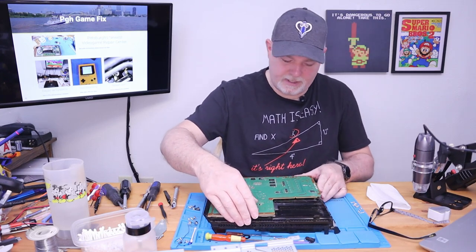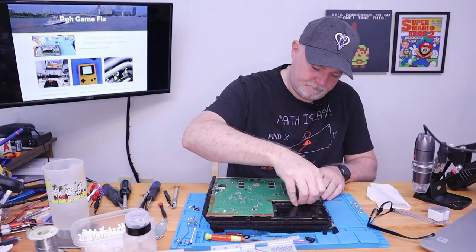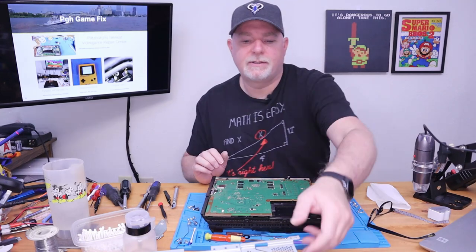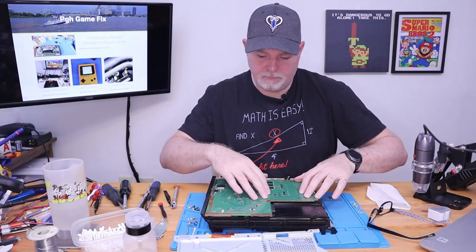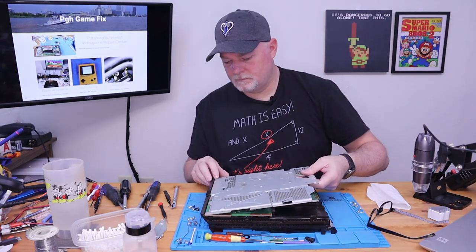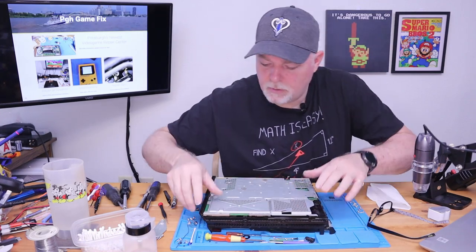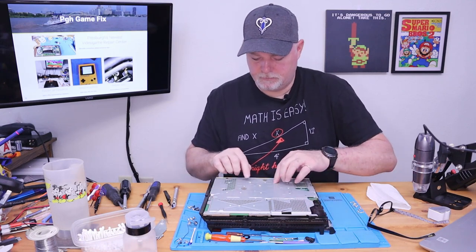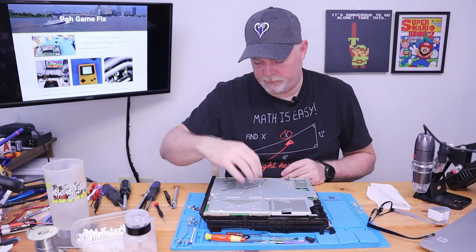Now, the one other thing you do have to keep an eye on are these thermal pads. Make sure that they're still on your chassis. Okay, our board's down. Here again, make sure this wire's out. Make sure we're all lined up, which we are. There's plastic guide pins. And I like to start with the clamp. Some people don't, some people do.